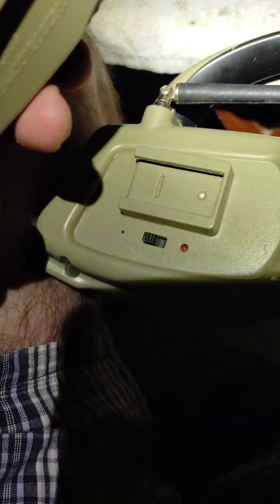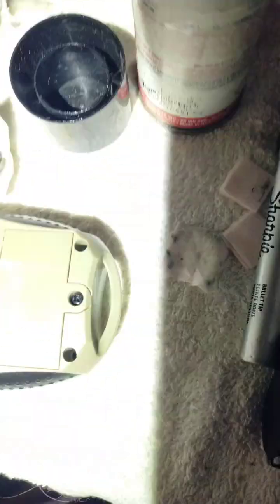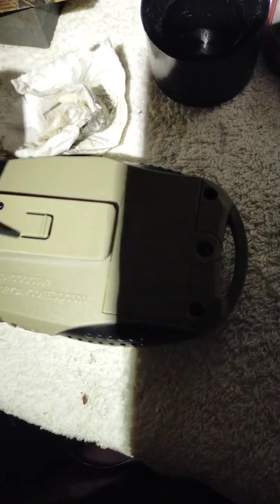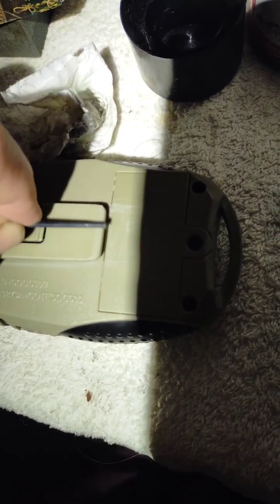So it was always a bit too firm to place the remote in there. That probably added to that bracket breaking because it was way too much pressure. There's that little clip there which goes into an indent there. At first I thought it was the sides making it hard, so I carefully filed and tested the sides, but then I realised it's that raised lip at the end acting like a spring, so I carefully filed that down.